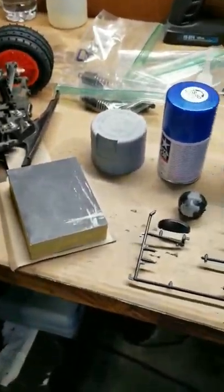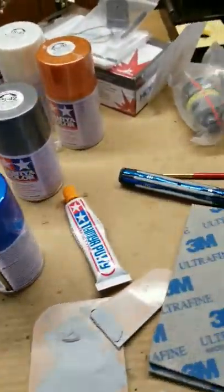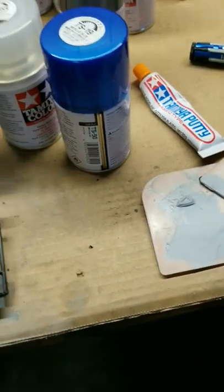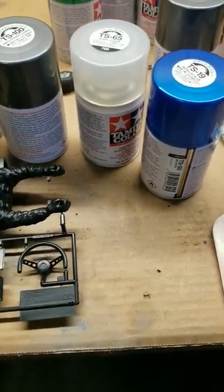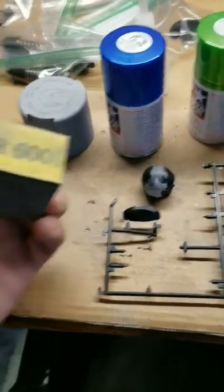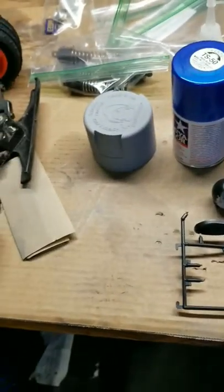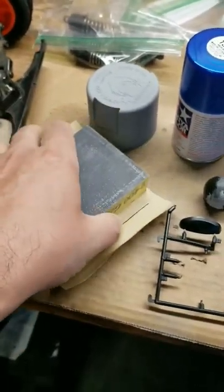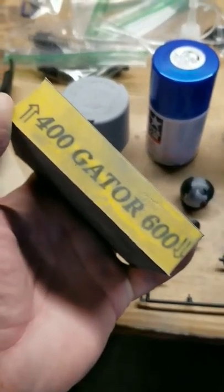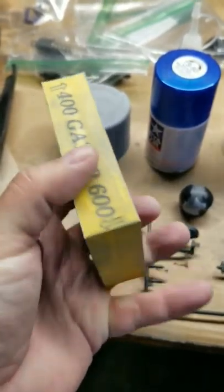A quick side note on the filler: I just use a basic type putty and a standard car applicator to put it on. When I knocked it down once it was dried, I used 220 grit — I think maybe a 300 would have been better because the 220 cut pretty quick and took a little work to get the scratches out. So maybe 300 grit to knock down the putty first. Once I got it down I went to 400 and 600 grit, which I also used as a block for knocking down the putty to begin with. The 400 takes it down a little bit more, the 600 touches it up a little bit more.